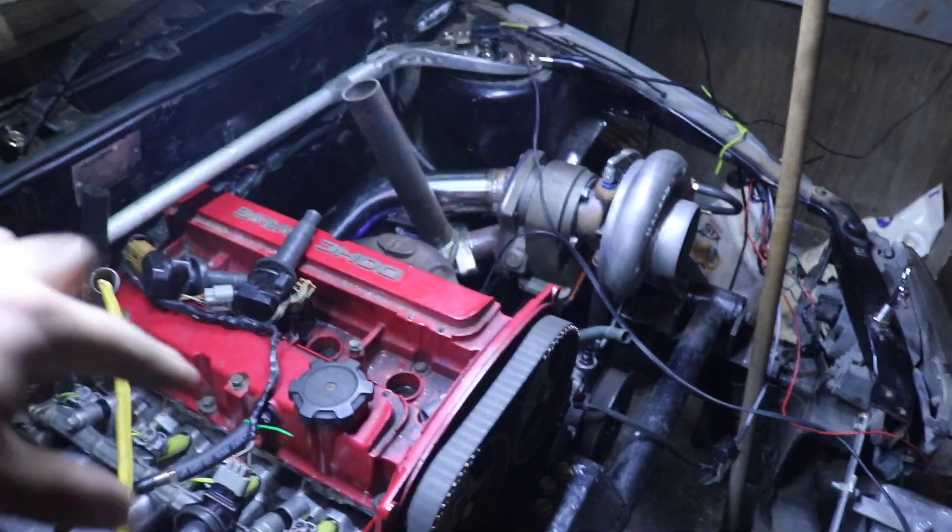So I came up with this plan: instead of wiring them in dual, I made all the coil packs individual. Coil number 1 fires on tooth 0 and 12. Coil number 4 fires on tooth 12 and 0. Coil number 2 fires on teeth 18 and 6. Coil number 3 fires on tooth 6 and 18. So that makes them sequential — 4 and 1 will pop at the same time, and 2 and 3 will pop at the same time. Hopefully that's my problem, because it felt like it was flooding right away, which makes a lot of sense. I'm going to gap these spark plugs, then we'll try and fire up again.